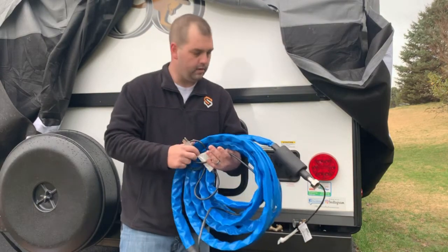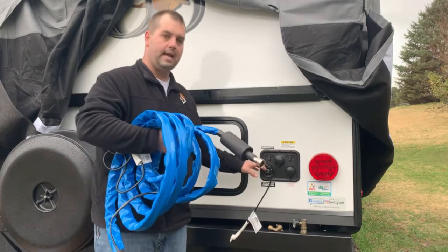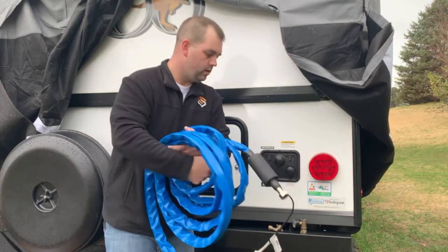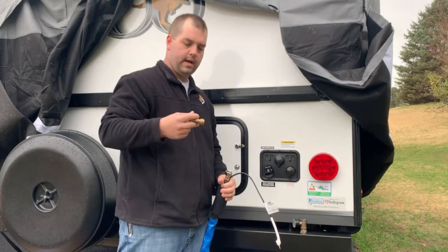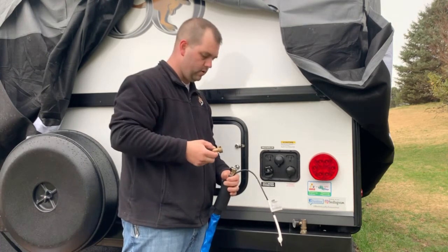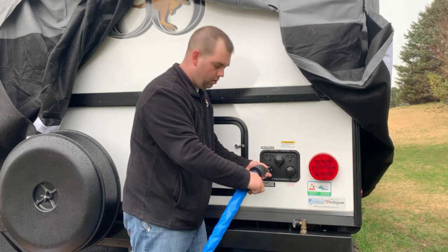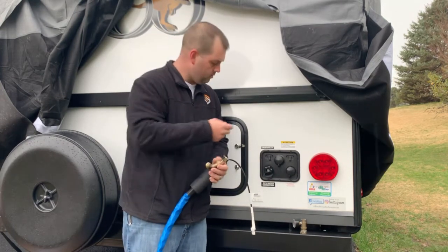The way we're going to hook it up: we'll keep the thermostat at the unit since our connection is on the outside of the camper, then hook up at the pedestal with the female connection and 120-volt power outlet. One tip I read is to pick up a 90-degree brass water connection elbow, also made by Camco. With a flush mount connection, it takes the tension off — if the hose were full of water it would be pulling down. It just helps protect the fitting, since it's plastic.